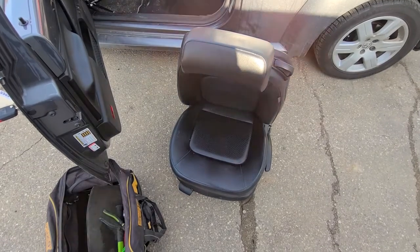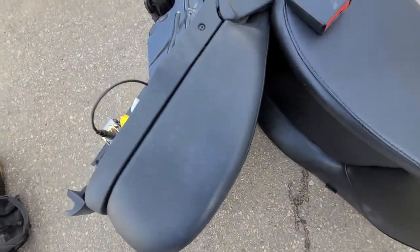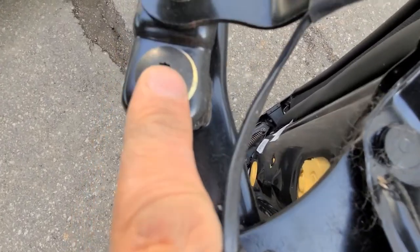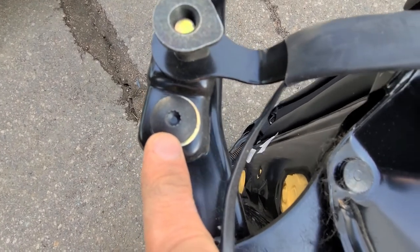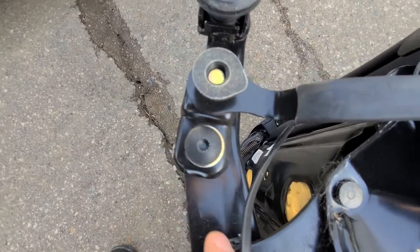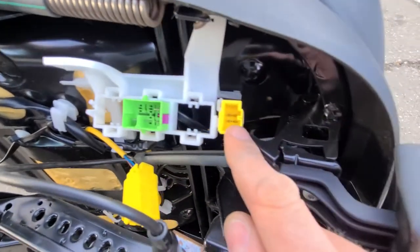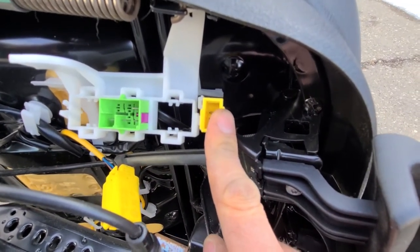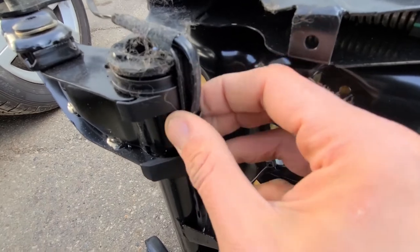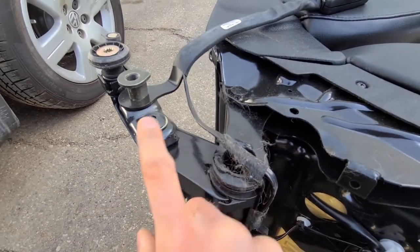Once you have the seat out, you will have access to the seat belt buckle — just turn the seat to the side. The buckle itself is held by only one screw right here, so you'll have to remove it. You also have to pull out this wire; the seat belt connector is the small yellow one you recently disconnected. You'll have to route this cable all the way out, then remove this screw. The tool you need is an M8 socket — it's a specialty tool for these German vehicles, but you should be able to buy it at any tool store.